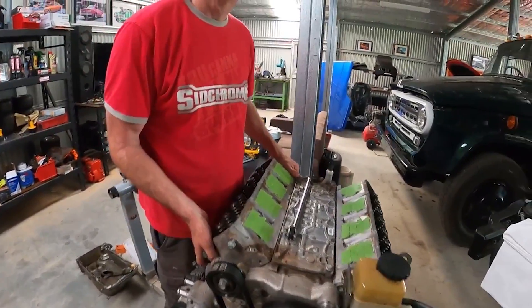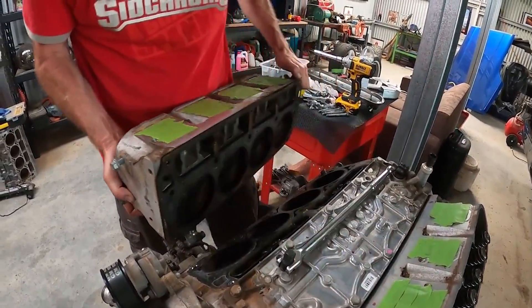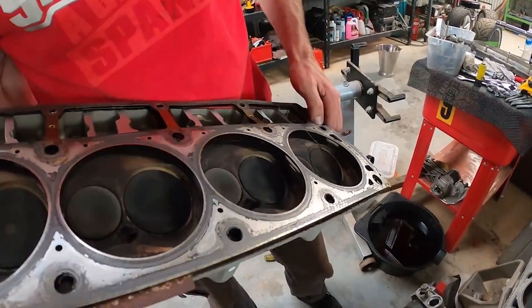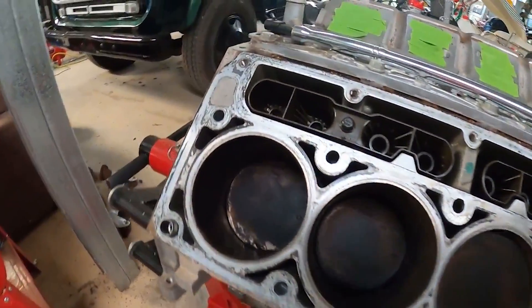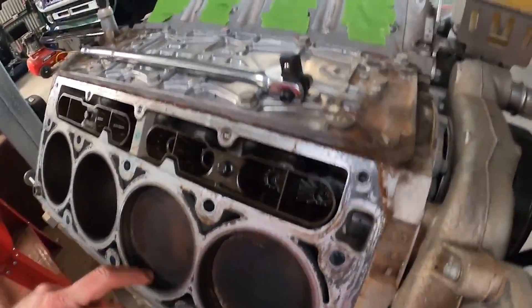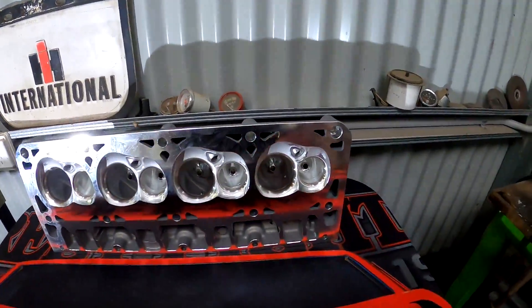All right, let's pull this head off — big reveal. Oh, gaskety there. Those heads don't look too bad, they're a bit carbony — well that's what you sort of expect. They're not coked up to the max. What we don't have is cracked heads or a cracked deck, which is good. Pistons look okay. And nothing down in the lifter trays — we'll have a good look at those in a second. Young Frankie pulling those heads off — did a good job and didn't do too much damage. But that was the basis of us taking those heads back to Higgins and getting these beautiful items here.